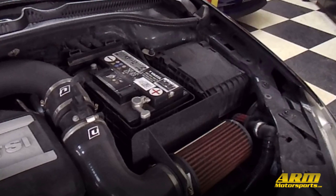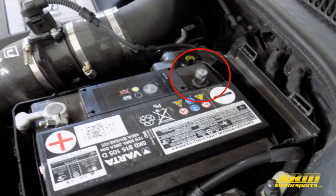The first step is to remove the negative battery cable from the battery. This is because in order to take the front bumper off we have to disconnect the crash sensors, and those are responsible for deploying the airbags. Since we want to eliminate any chance of that happening, we take this small step just as a precaution. To remove the cable, loosen the nut until you can slide it off the negative battery terminal. Position it in a safe place where it's not going to come into contact with any other metal parts in the engine bay.